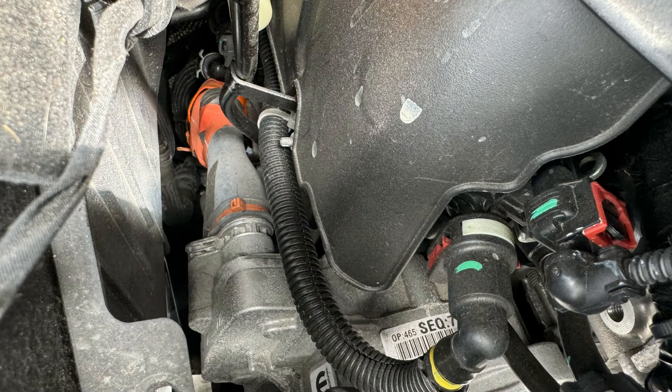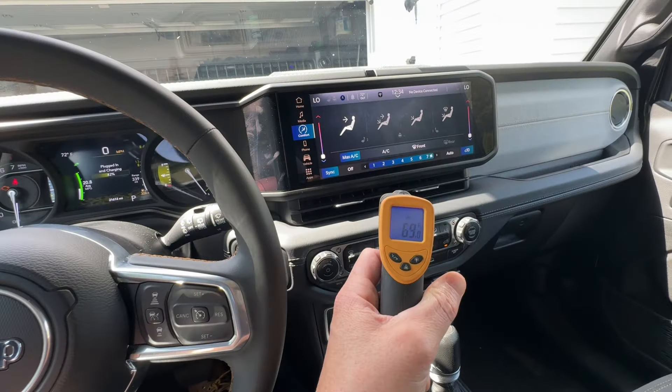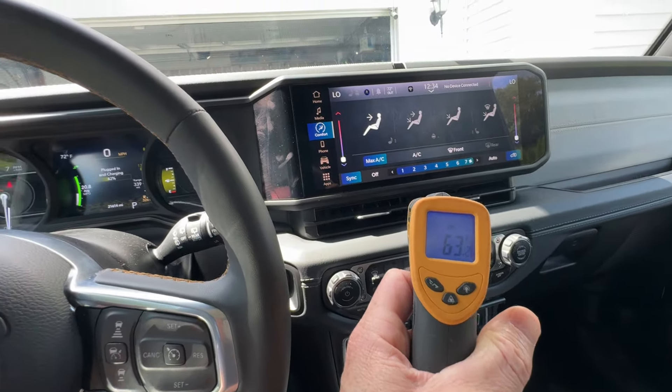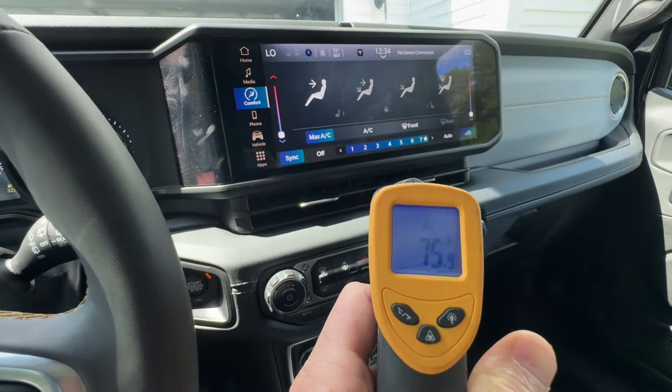On the left side of the motor you can see the 44 horsepower e-motor, which also acts as a starter and a generator. It's belt driven. You can see the orange high voltage lines going in, and on the right hand side you can see the air conditioning compressor — it's totally electric, high voltage powered. If the traction battery is charged, you can run the air conditioning or heating without the gas engine running.